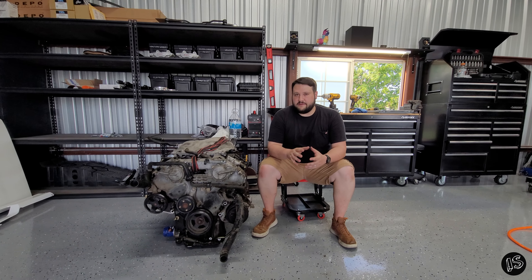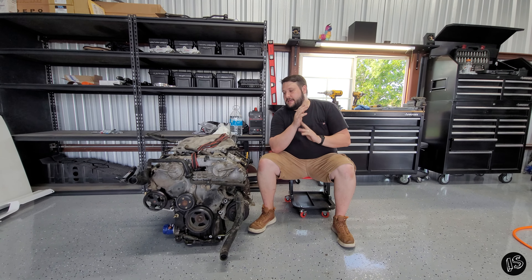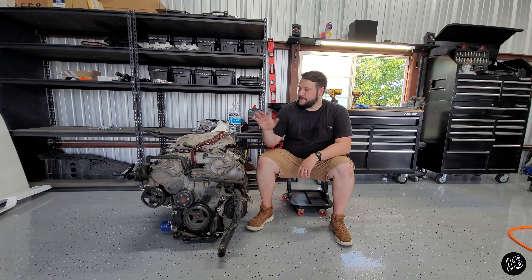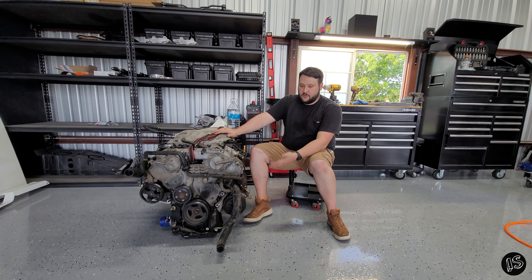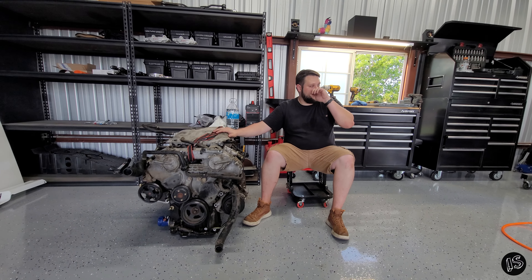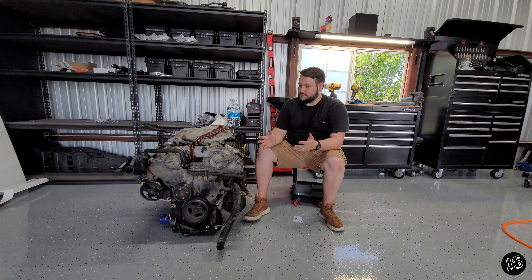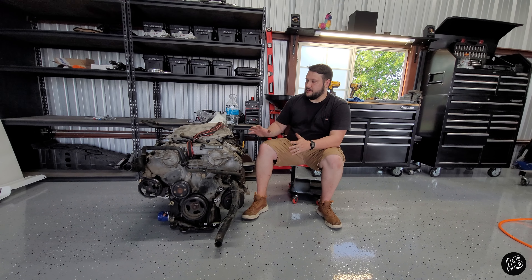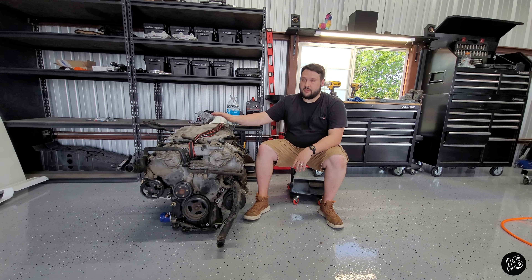Cool deal. There's something I found that was kind of interesting. I went back and watched episode three of the engine weight series — that was when I pulled the KA24E out of my D21. As it turns out, that engine, fully dressed, weighs 424 pounds. This engine, if you decided to swap it into your D21 and you weren't going to run AC, weighs 423 pounds by itself. Obviously the whole swap is a little heavier because the transmissions on these are heavier than the KA trans, but we're talking about the transmission being at a lower center of gravity, further back from the front wheel centerline. You're probably going to improve the weight distribution of the truck. And if you relocate the battery to the bed of the truck, you're just making big improvements. I just thought it was really interesting how close in weight these things were. Some people might think that swapping a bigger V6 in, you're going to lose handling characteristics because of the weight difference, but that's just not the case — if anything, you're probably going to improve them.